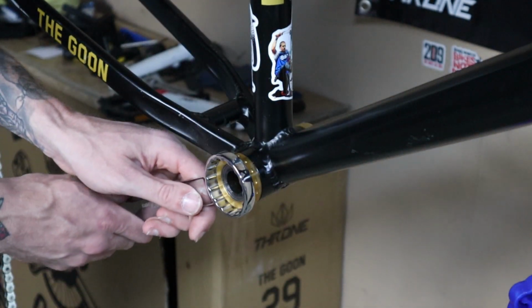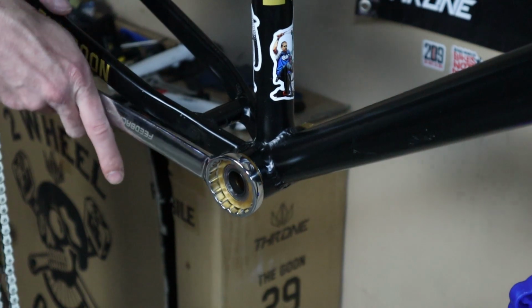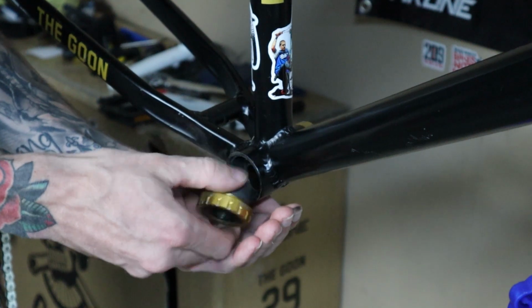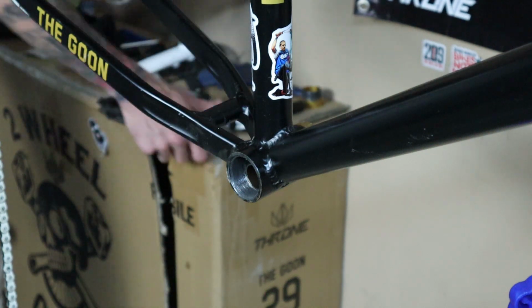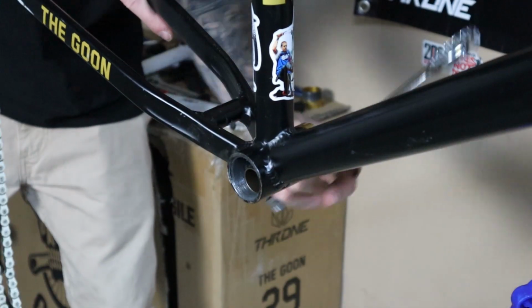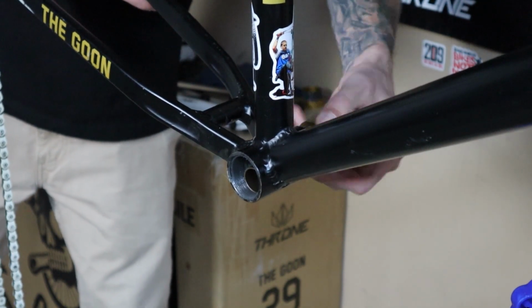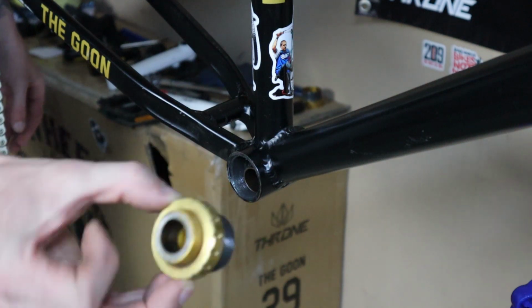It's a bottom bracket removal tool. It's specially fit. And you're always gonna wanna go towards the head tube. Boom, that's gonna loosen it. All right, there she is. This one's a gold bottom bracket off of a Fast Ripper that I got from Jacob Santos. Shout out to Jake for hooking me up with that. Oops. Broke it free. All right. That guy all the way out.